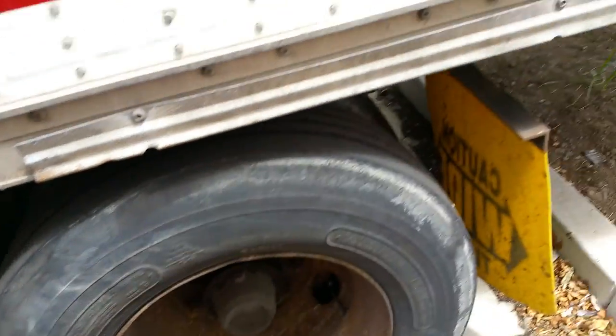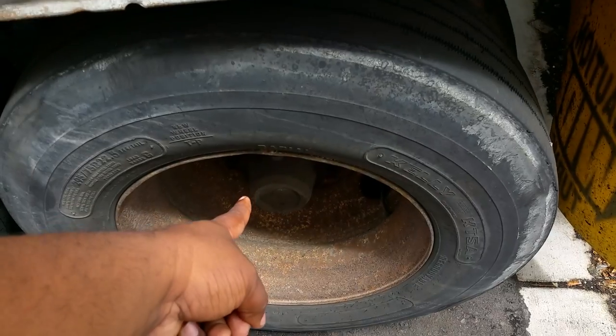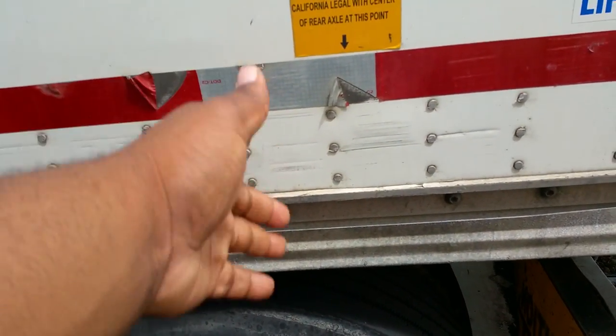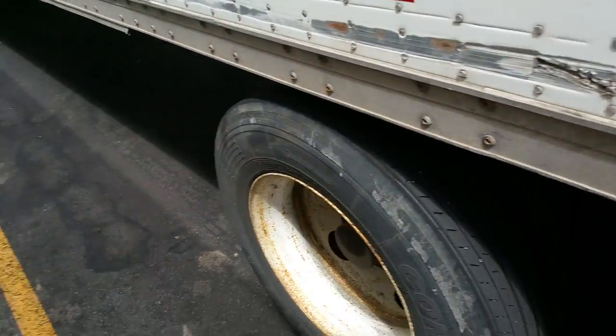Each hole represents four to five hundred pounds. Make sure if you're going to California that your tandem hub axle cap does not pass that marker line — I know that because I passed the pre-trip at the Swift terminal. That is how you adjust the weight on your tandems, drives, and steers. It's going to be hard the first couple of times because you're getting in and out of the truck, but it gets easier.